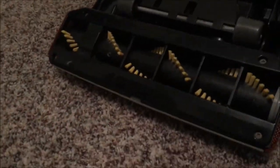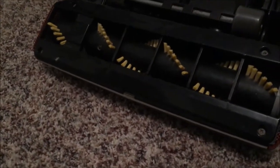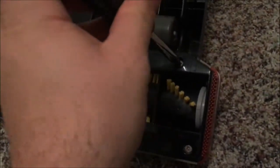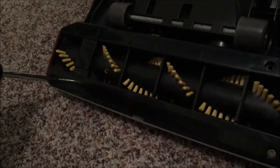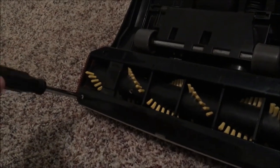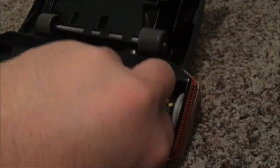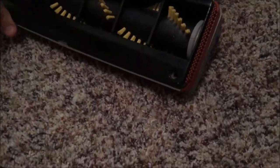There's the brand new brush roll I got — it's a Cleveland Wood Products brush roll. The original brush roll on this was actually serviceable before I threw it out, but I thought the bristles were kind of worn down so I figured I'd update to the Cleveland Wood Products. This is actually the same brush roll company that makes the brush rolls for Kirbys, which is what really turned me on to it. You're going to want to remove these screws to the bottom plate — sorry I'm not showing you all the footage on camera, it's just hard to look through the camera and do this at the same time. Pull your bottom plate off, which by the way could use a good cleaning.